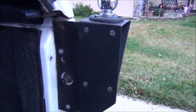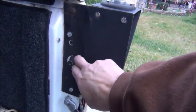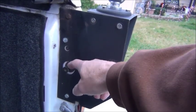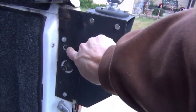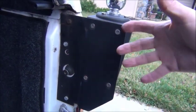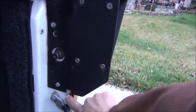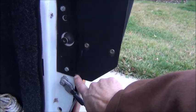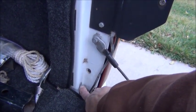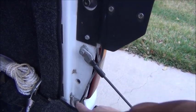It's hooked on with several bolts, and I cut a couple of holes — one for the tailgate latch and another for the screw you loosen to take off the tail light on the other side to get to the light bulbs. There's also a bonding strap that's been soldered onto the steel here and attaches down to the body with a bolt and a star washer behind it, with the paint removed behind it to get a good ground.